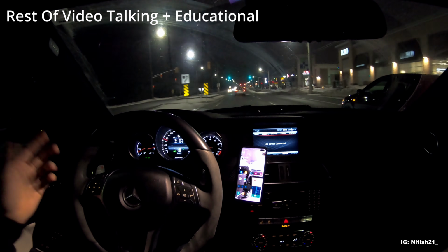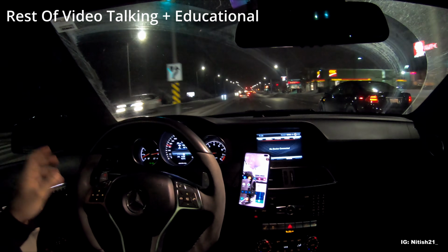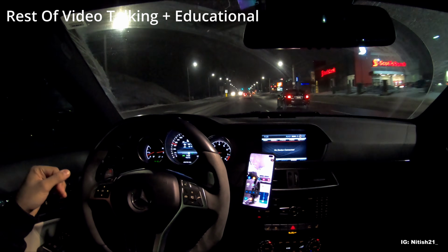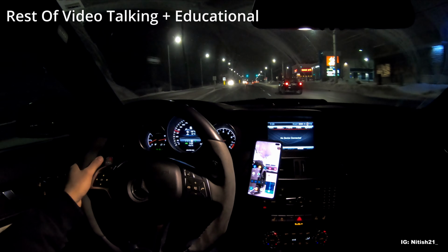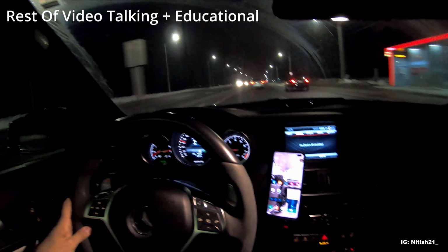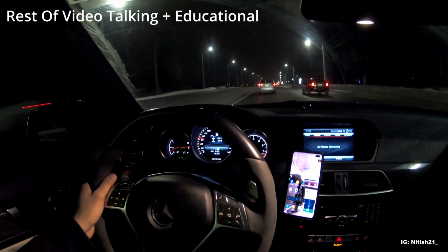And a lot of you may think an exhaust leak isn't that costly towards performance, but what you don't understand is that when you have a car that requires the turbo to spool up as quickly as possible and make peak boost to make the power, if you do not make peak boost because all your exhaust is not able to spool the turbo because it's leaking out, all you end up with is a car that's making less boost than peak, and it's taking longer to spool to that level as well. So we're not ending up making full power at all.